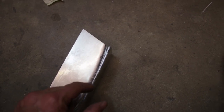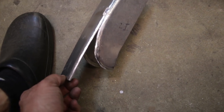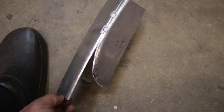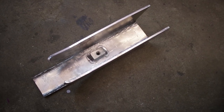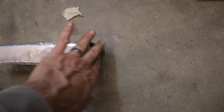I've taken it off the car just so I can get these gaps tightened up a little bit. You can see up here on the upper left this gap is opening wide, which is intentional because this curvature needs to curve in more to meet the shape of the deck lid on the top. This side is the inside and also needs to be tightened up at the top. As we get around to the bottom we have some very sharp edges to form around. The idea is to weld and go, form, and then check it on the car - this will take multiple attempts to get the fit correct. It's now holding its shape from the backside. I'm glad I put the block in first because it would have been difficult to access after these sides are on. There will be a cap that goes on the top to close out this U-channel completely.